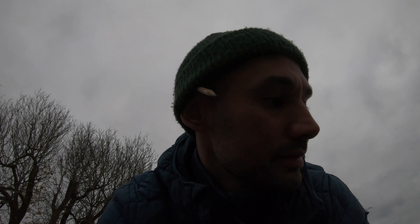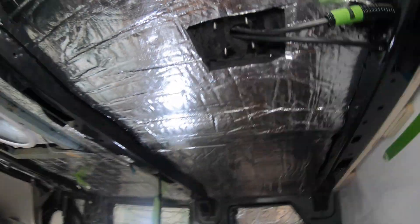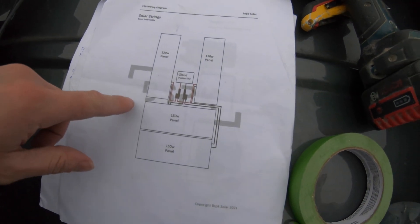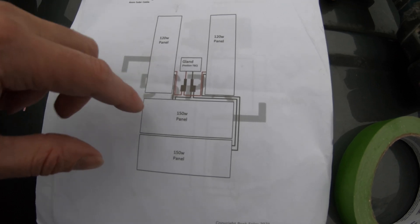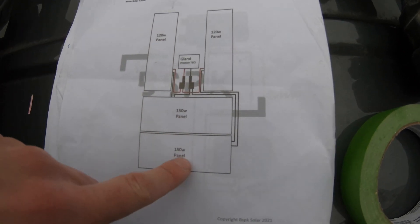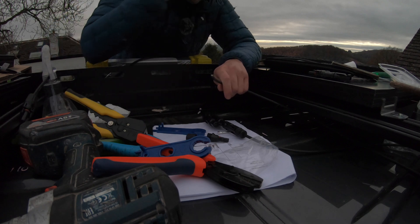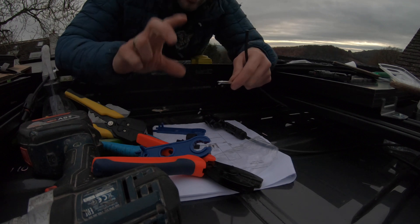I'm not joking — I thought I'd get a lot further today; that took loads longer than I thought and was actually quite fiddly. I've had a change of heart: taken out the screws and it recommends using M3 bolts to make sure it doesn't leak. It's been a couple of days and it has rained. So bolts coming through with a washer and a nylock nut. This is my electrical diagram from Bespoke Solar — we're going to split the feeds and wire one 120-watt panel in series with a 150-watt panel going to the splitter, then the same on the other side.